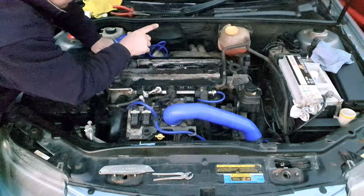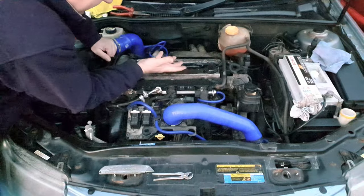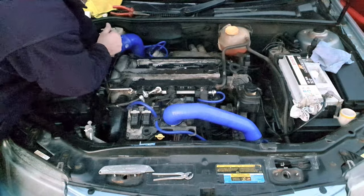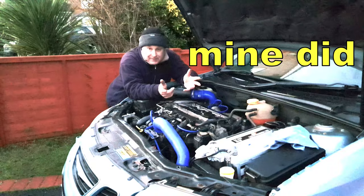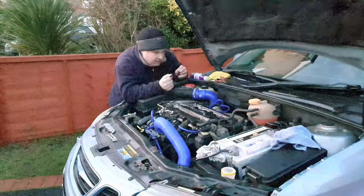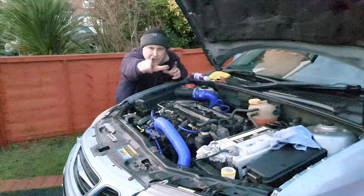These plastic lines tend, as they get older — from 10 years upwards — to become brittle and break quite easily, which again allows vacuum leaks, and you also tend to find that you're not getting the brake assist you need. It wouldn't surprise me if you find your car runs better and smoother after replacing these vacuum hoses, even if you couldn't see any obvious splits or leaks. If you got value from this video, please consider supporting the channel in some way, and I shall see you next time.